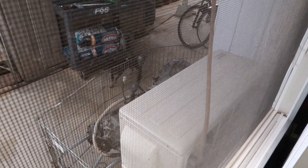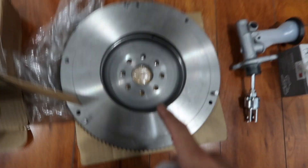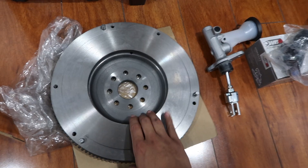Not just any transmission — the five-speed transmission specifically. If you have a first-gen Tacoma like me with a 3.4 motor, you're going to need an R150F. If you're four-wheel drive, you'll want the driver-side drop transfer case version. The next part you need is a flywheel.